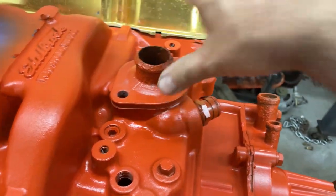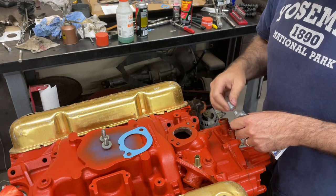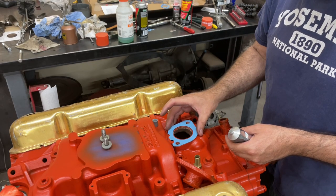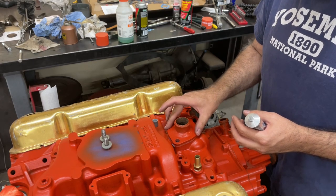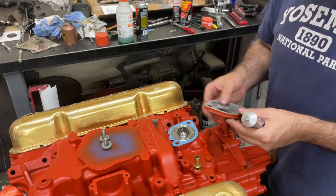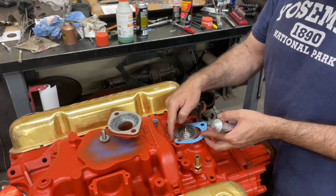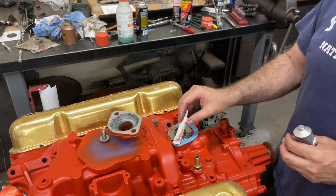What does RTV do? Oh, this other stuff over here. So it's my little helper's bedtime, trying to get this thing wrapped up. Making sure everything is right where I need them. No rockage. Make sure everything's seated - once you get it in there right, it doesn't rock at all. I think it's catching on the edge of the thermostat. I've got stainless steel bolts. I double-checked the holes here, as well as the small bolt pattern hole set - they do not penetrate the water jacket. Check your manifold if they do, because you're going to need some thread sealant on them if they penetrate the water jacket.